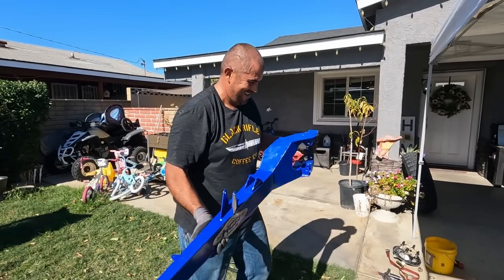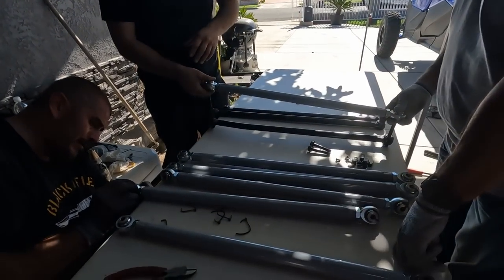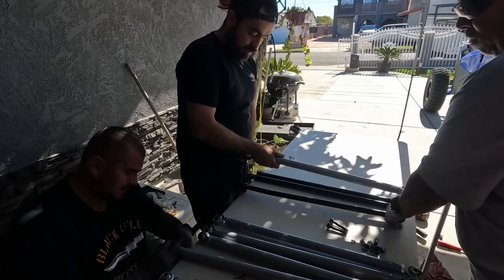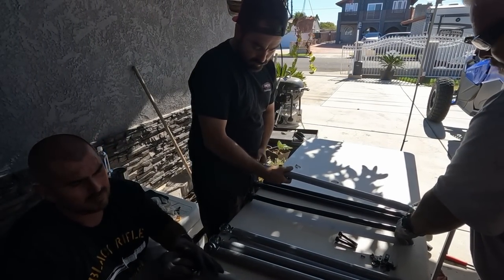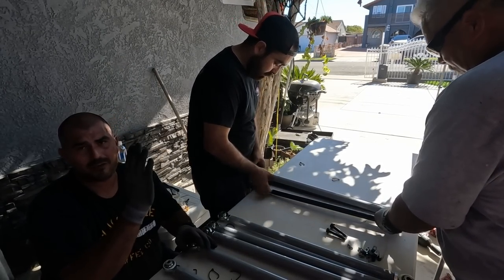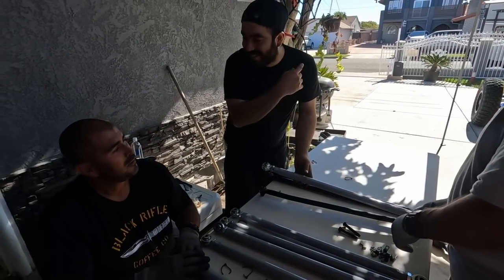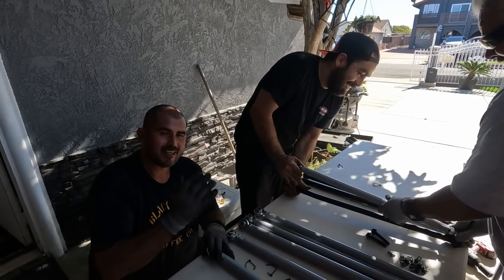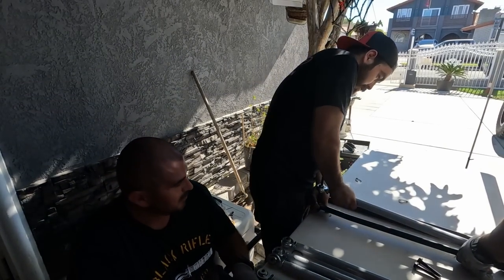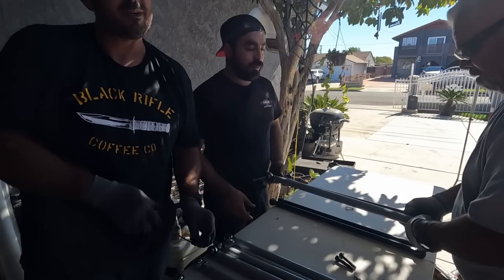Martin's got the 72-inch LMUTV radius rods — straight aluminum, solid round bar. The heim joints are three-quarters inch versus five-eighths on stock — big upgrade. You lose some clearance but you gain strength and less chance of bending. The reason I went with solid round bar over the high-clearance style is that the high-clearance has a flat square edge, and since I do most riding in the desert, trails, and Johnson Valley, I don't want a rock catching that flat face. The round bar just bounces over rocks.